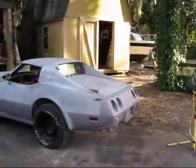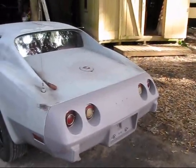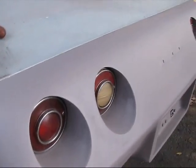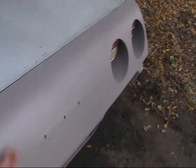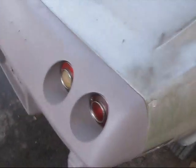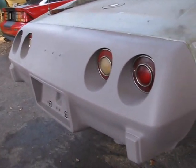I got both the front and back rubber bumper parts covered in primer — just put a couple of thick coats of lacquer primer on there, the old stuff from my dad. I also put the lenses back in the tail lights. It looks tons better just being a uniform color and quite a bit smoother. It still needs spot putty and blocking down quite a bit, but it looks tons better just like it is right now.